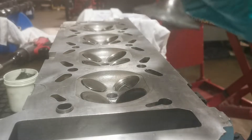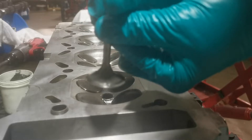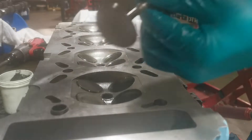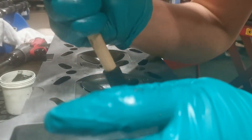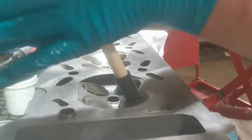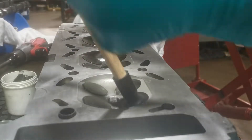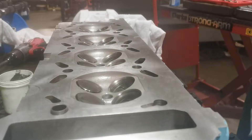Now you can see the difference in tone. You can kind of see the light gray surface there - it's a little bit out of focus but you can still make do. You can see the light surface has been ground around, but I'm going to do a few more passes just to make sure. You might be tempted to use a drill to speed up this process but don't - you want to use your hands, because with the weight of a drill you can lean left, right, anywhere and put too much wear on one side.